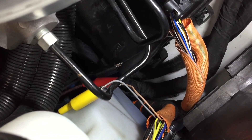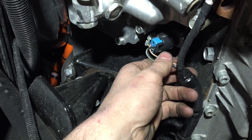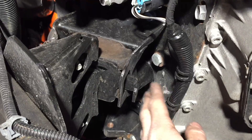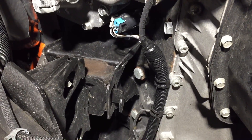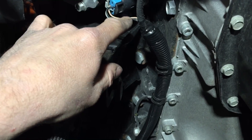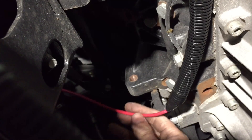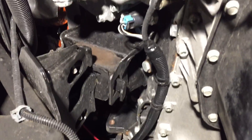Here's my finished project underneath the bus. You can see the wires neatly disappear into the wire loom where the new wire was run. I added wire loom here — there didn't used to be any — to support the additional wire. I ran a heavier gauge red wire because the wire would be running unprotected and exposed up to the PCM. This red wire is the new oil pressure signal wire.